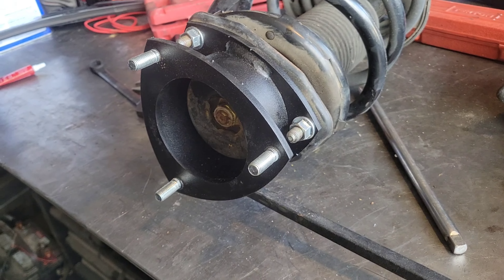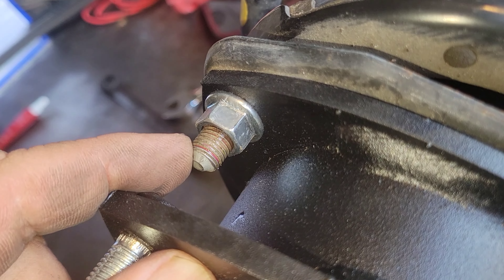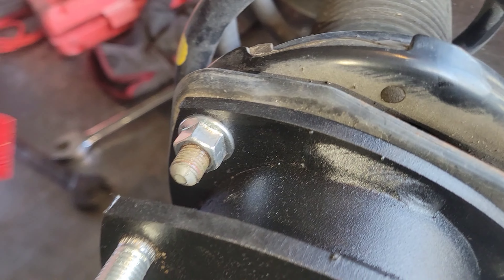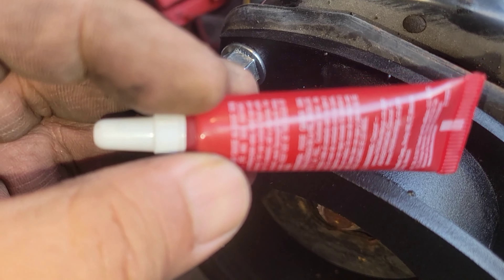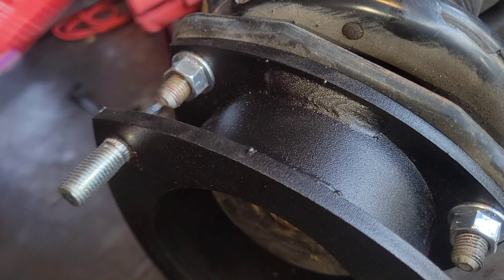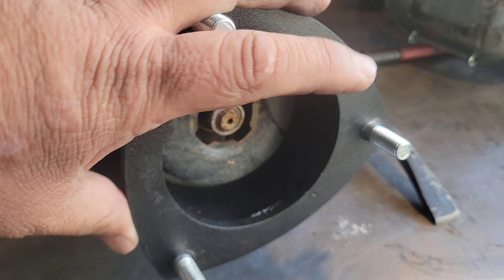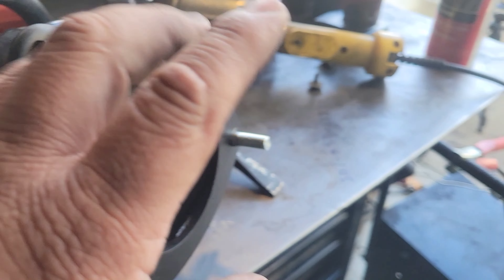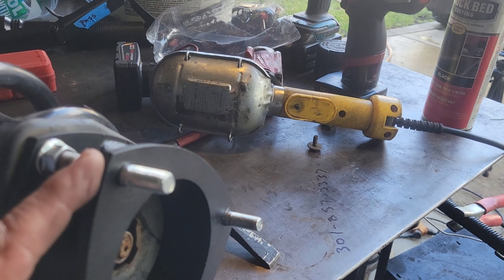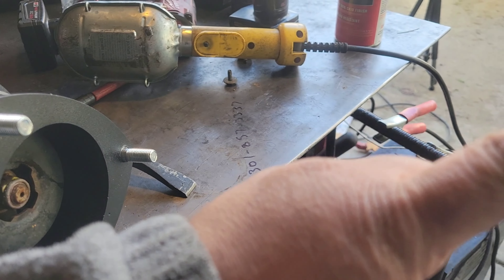The spacer is installed onto this top hat here. If you look really carefully, there is red Loctite on it — it's really good if you want to make sure something stays tight. We're going to install this back onto the strut. Another pointer: this thing right here rotates freely, so when you put it back in there it's probably not going to fit the way it was before. However, you can rotate it so that it'll fit those holes up on the tower mount.